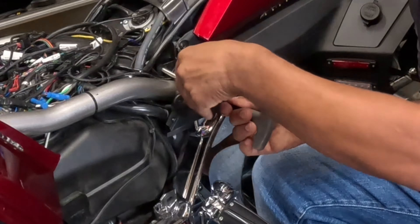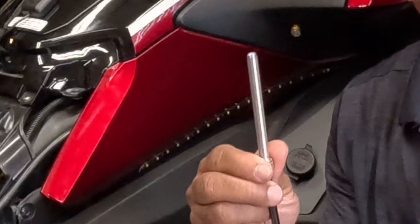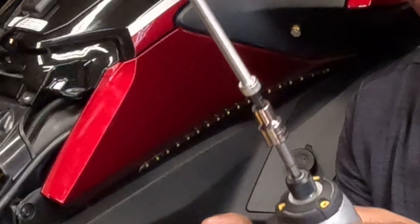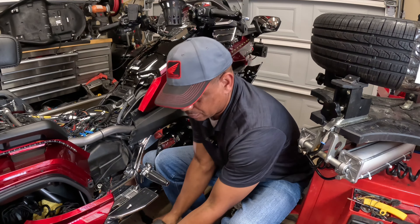But as you notice, the bolt is stopping — it's going in crooked. For some reason, I don't know why Honda didn't tap those bolts like they should. Try a new bolt with a little bit of oil and see if you can push it through. If that doesn't help, you can always take a power tool and try to push it through, but that may not work either. So I had to do this to the other side, and I'm just making this quick video to show what I'm having to do. I'm having to re-tap the thread because it's just not going in like it should.